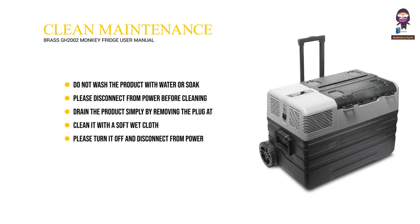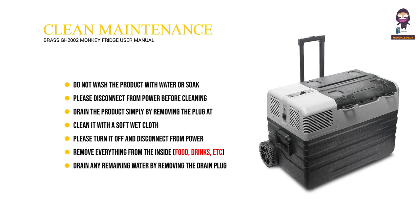Please turn it off and disconnect from power. Remove everything from the inside, food, drinks, etc. Drain any remaining water by removing the drain plug, then wipe all internal surfaces with a soft cloth to ensure that they are clean and dry. Keep it stored away from wet or humid places.